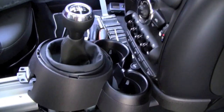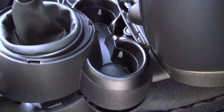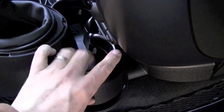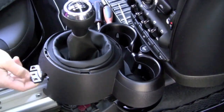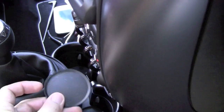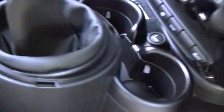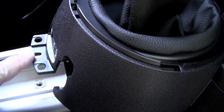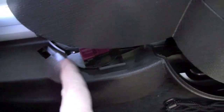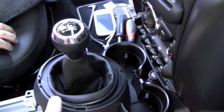What we've decided to do is lift up the boot carrier and the drink holder — it's all one piece. To do that, you take out the little rubber parts at the bottom of the drink holders; there are two torx screws there. Then there's the one that holds it onto the back of the rail. The rest is just held in by plastic clips, so just lift up on it. You don't have to take it all the way off.